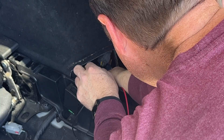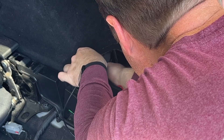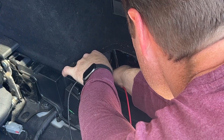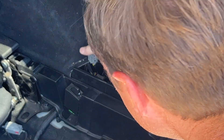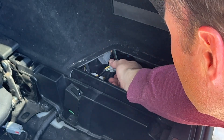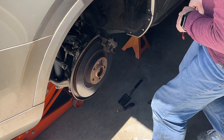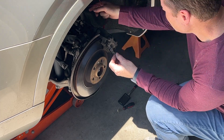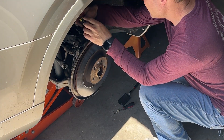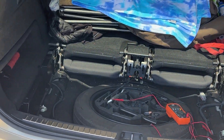Got my 9-volt battery again. Going with the orange-yellow and the green-white. I'm going through the back of the connector here. Don't hear anything. Reverse the connection. Could it be that simple? Could it just be a broken wire between this connector and the underside of the car? Should be able to jumper this right here - actually I can't get an alligator clip in there. Maybe a paper clip will do the job. Just get a jumper for these two here and see if I get any continuity.